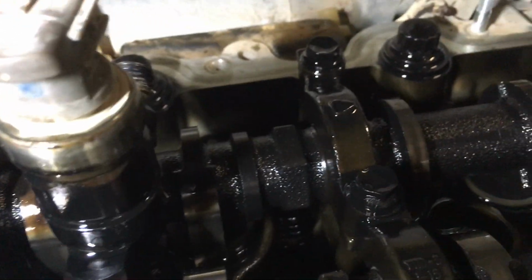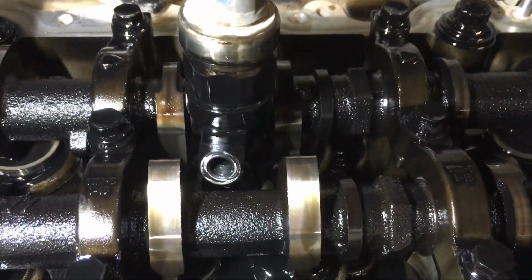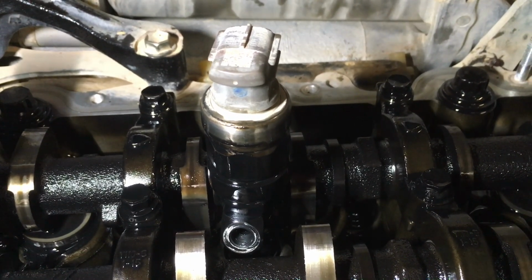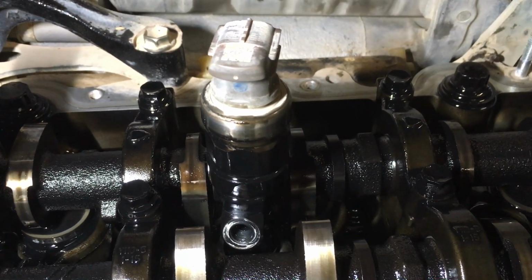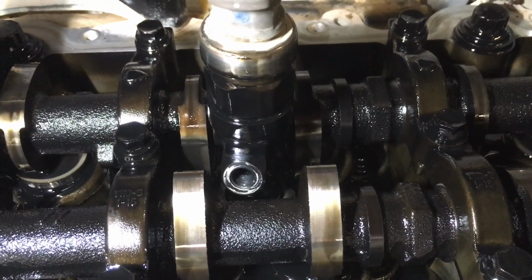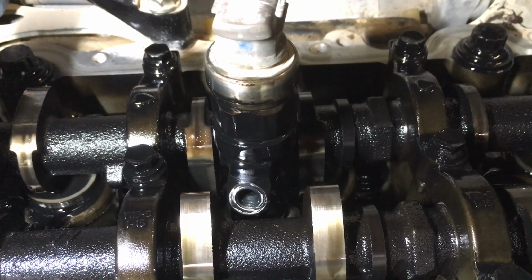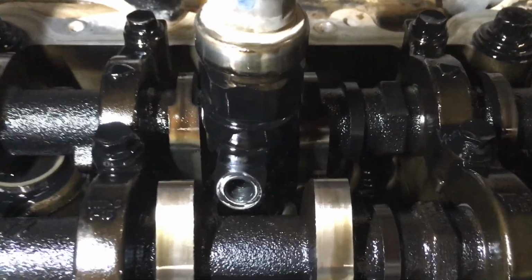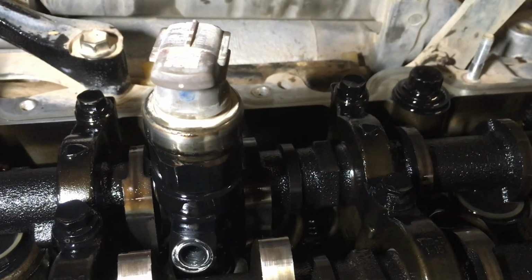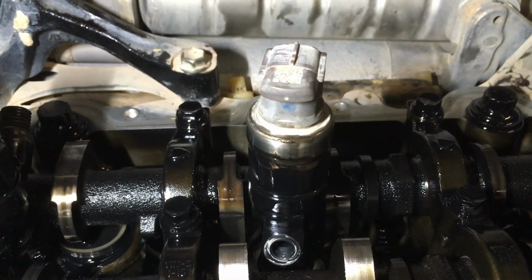At this stage, a big shifter on the injector inlet around that side has worked so far, but you need to be very careful not to slip. Generally, it's a one-man job, because if you've got two, you're not in sync with each other. You need to bounce your leverage on your left side, levering to push up, at the same time as you're twisting at the other side. If it doesn't happen at the same time, you end up twisting or levering, and neither works. You can lever this till the end of the day and it's not going to come out. You can twist it, it's not coming up. They need to happen in sync. All right, I'm going to charge up and then we'll get on with it.